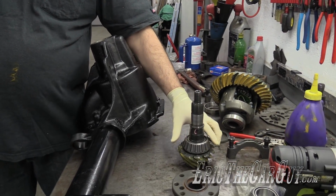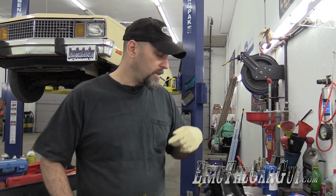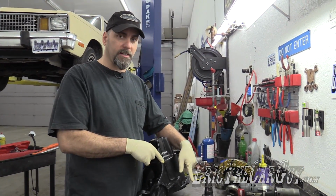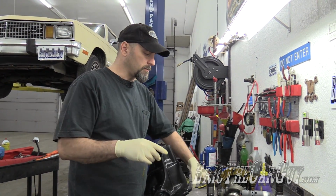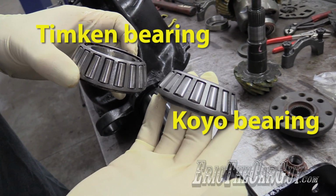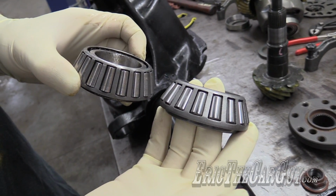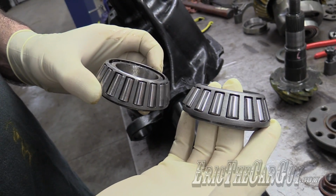Well, the reason why I'm doing this video again is because I did that very thing. Don't do this. You have 2 options. Purchase another pinion bearing, a separate one, and hollow it out in the same way I did if you want an easy setup pinion head bearing, or have a really good bearing splitter, and I'll show you why. So here's the old bearing that I took off and hollowed out, and here's the new bearing. And you can see they are very different. And because of that difference, it made it impossible for me to set it up and get a proper gear tooth pattern. So here's tip number one that I can give you.